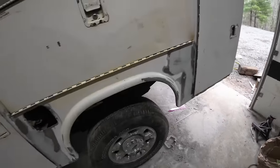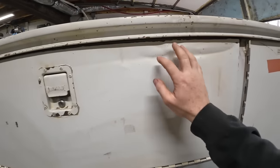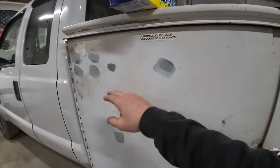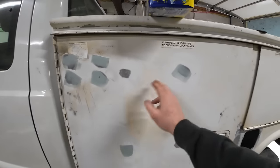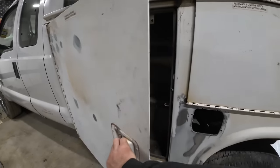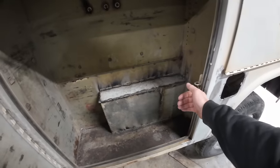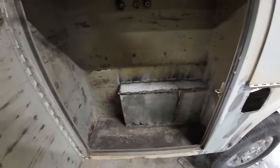That's pretty good. So like this dent in this door, that's too much. If you put filler in that, where this is constantly slammed, it'll break and fall out. These, where they had little signs mounted, I put a little bit of putty in these. So I need to sand that down just to fill in some imperfections where I welded it. No big deal. But I went ahead and got all these welded up where I had to cut out for that spring perch. So I got this all boxed in and welded up nice.